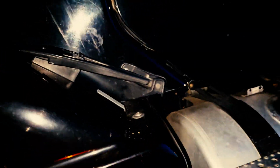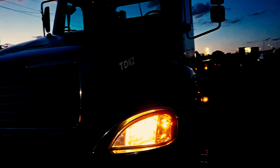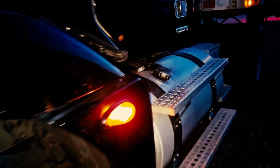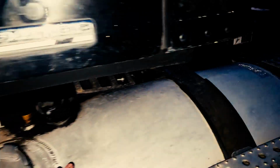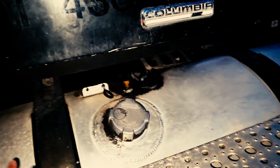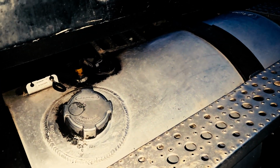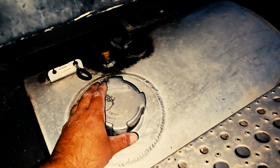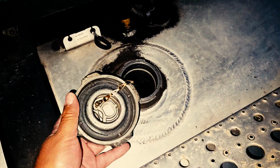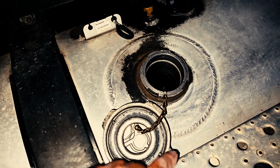Okay. Now at this point, you're going to continue the outside inspection. You're going to look down your rig to see if there's anything that you missed on your initial inspection, and then you begin. I'm going to inspect my fuel tanks on both sides of my vehicle to ensure that they're properly mounted and secured. Neither cracked, damaged, nor loose, free of any illegal welds, no signs of any leaks. I'm sure that my cap is properly latched, has a security chain, and that it has a proper seal.